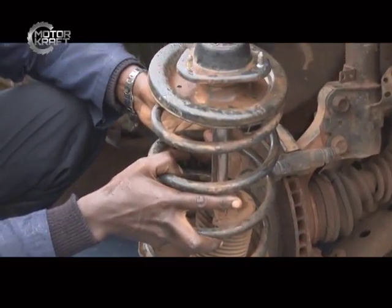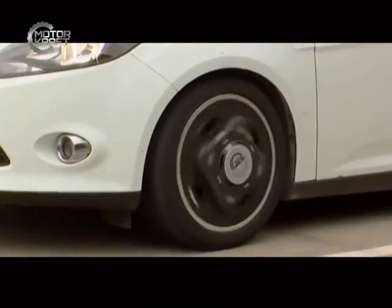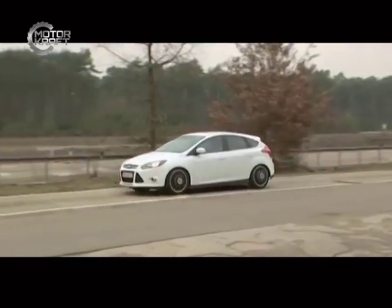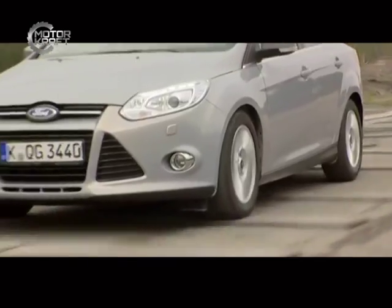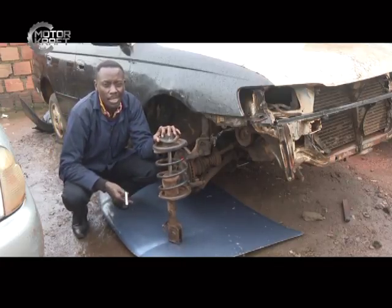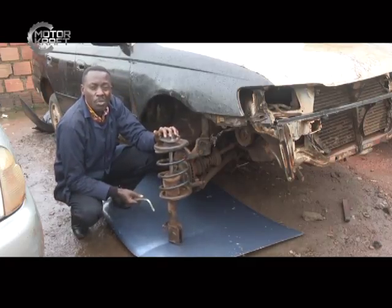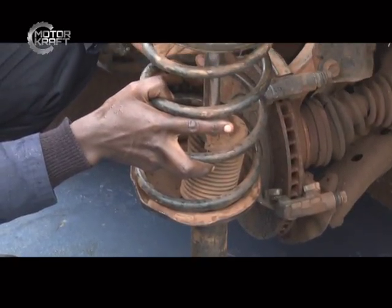One thing you should know about coil springs is that over time, with use, they lose their spring ability. Whenever the vehicle goes into a hump or ditch, the oscillations don't become as effective. At that point the vehicle can sit a bit lower, and once the spring loses its ability to stretch, you need to have another spring replace it. Sometimes replacing with a longer spring will improve the vehicle height but also make the vehicle more rigid, so it depends on what you want from the spring replacement.